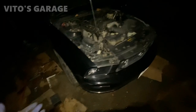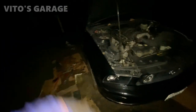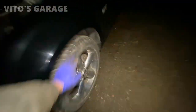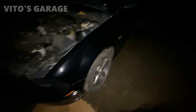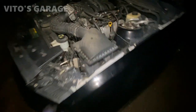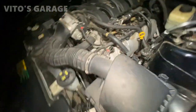And the car is on the ground now, the wheels are torqued, and yeah, I see the alignment is way off now. I'm gonna have to adjust it right now, but first I'm gonna push the car up and down and move it a little bit back and forth so the suspension can settle, because I need to tighten those two bushings that I was talking about. So I have to just kind of push it up and down multiple times.